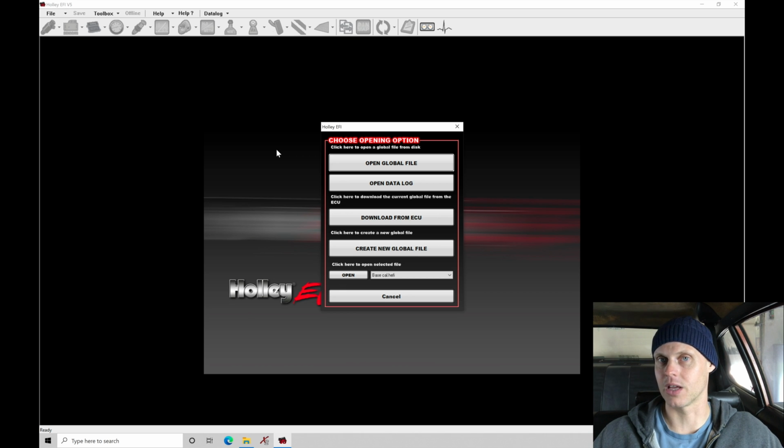There might be wrenches that get thrown in there that we might have to overcome. There are some specific things we probably have to take a look at in terms of adjusting the injector data, because these injectors are kind of an unknown, without having to go in and start to absorb those deviations or differences in our main VE table. We might have to tweak our spark timing. We might have to go in and deal with adjusting a mechanical throttle stop on our throttle body. There's a lot of things that we might potentially have to do here.